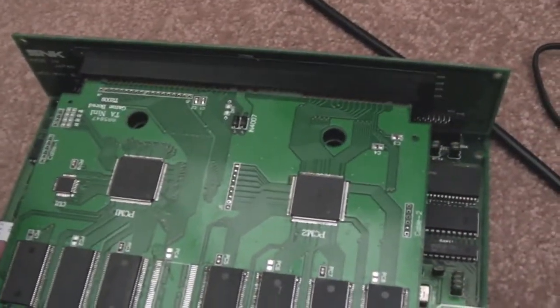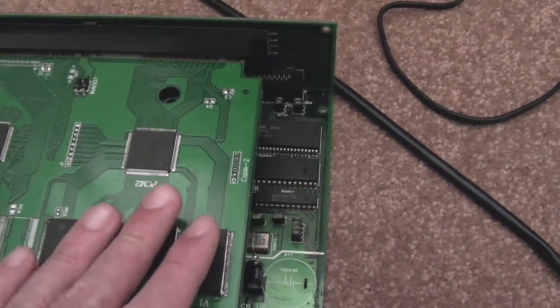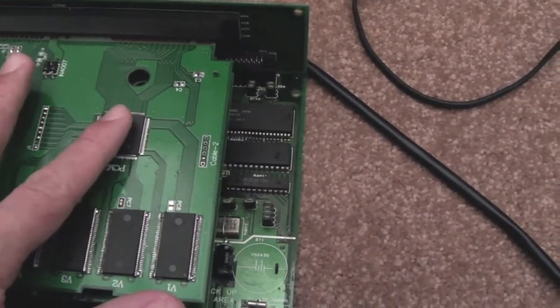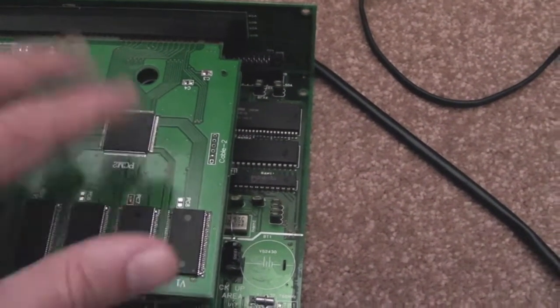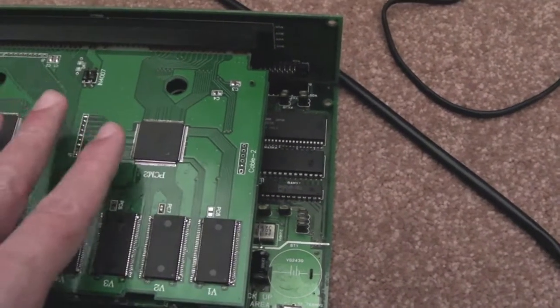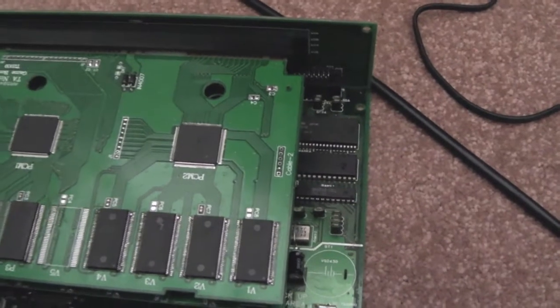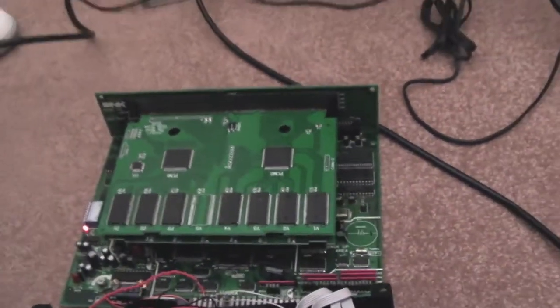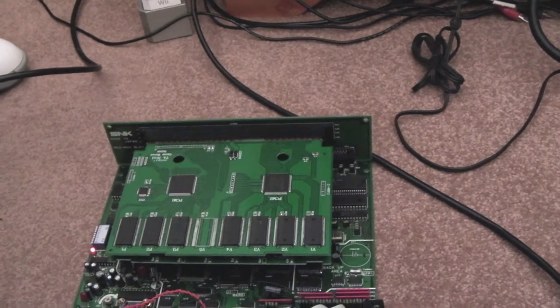If I get a problem like this, I have to dig down, like I did with the corruptions and things, understanding, is it the CPLDs or FPGAs or whatever these two chips are? No, it's not. I'm damn sure that the problem with the sound corruptions and things are the VROMs on these cards, but this, it's been running fine, aside from the fact that I've just replaced the Neo C1 chip. It's just very odd.